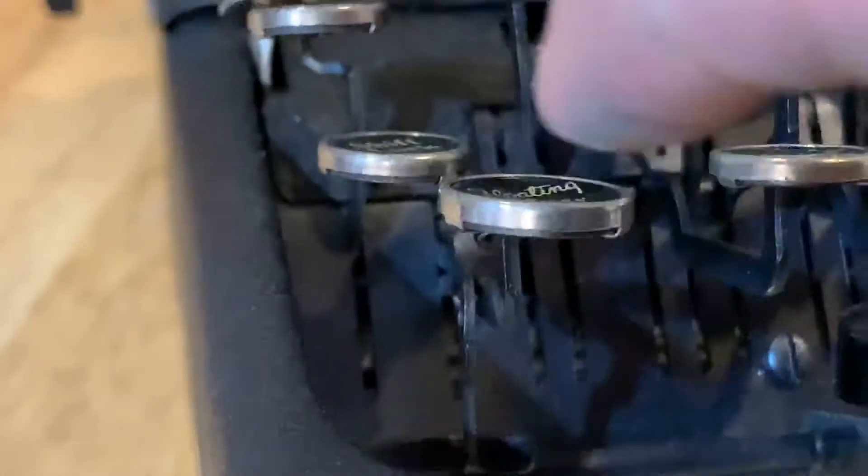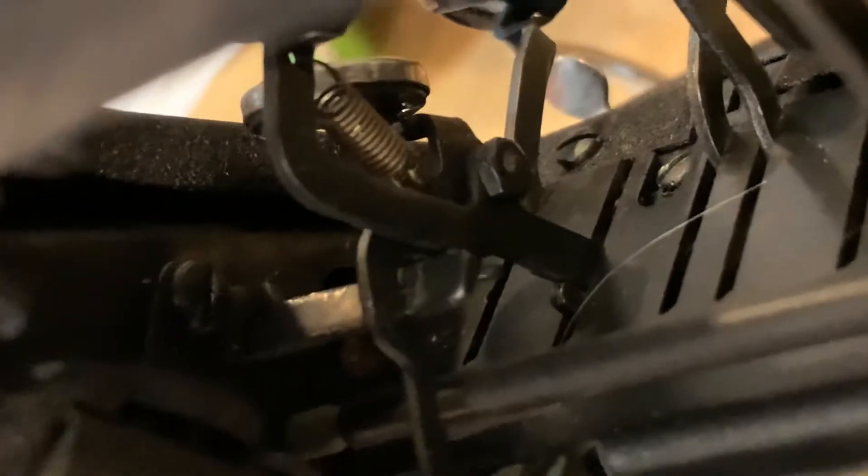The shift lock locks in, so somewhere in here it's not triggering. If you go underneath this way you might get a better view. See that bar — see how it clicks into it. Yours isn't clicking into that notch.